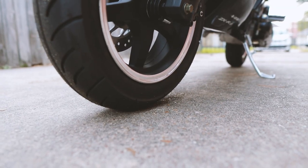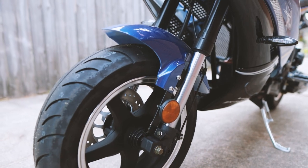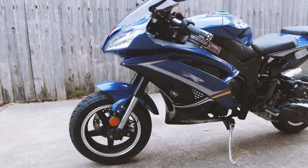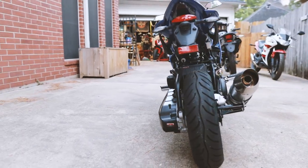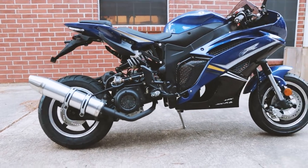AutoZone takes oil back for free and returns your container. I want to remind everyone: after this oil change, have a couple more ready. Do another oil change at around 100 to 200 miles and try to get three oil changes in before you hit 1,000 miles to ensure everything is cleaned out of the motor. That may seem excessive, but with a China bike like this there's no dealership or shop for warranty work, so you need to make sure it runs as best as it can for as long as it can. Be sure to subscribe for more videos on this bike and other small bore engine or motorcycle content — thanks for watching, like and subscribe!